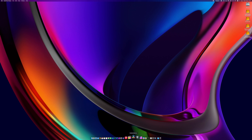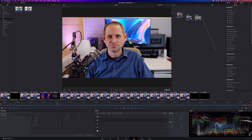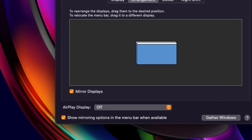I've been using the Mac Pro for video editing in DaVinci Resolve and for general office work since I installed Big Sur, and it's been completely stable. The eGPU has been plugged in the whole time and I haven't had any issues at all. Now you may be wondering if that dual display bug is still present with the 5700 XT — and yes, I'm afraid it is. Apple still haven't fixed this. So in order to get maximum performance from your eGPU, you either need to connect two monitors to it, or you need to have a monitor and a dummy display. So that's how I run mine: I've got my Dell 4K monitor and then I've got a headless 4K DisplayPort adapter. In macOS, I set the screens to be mirrored, and that works fine for me, and I get the increased performance.